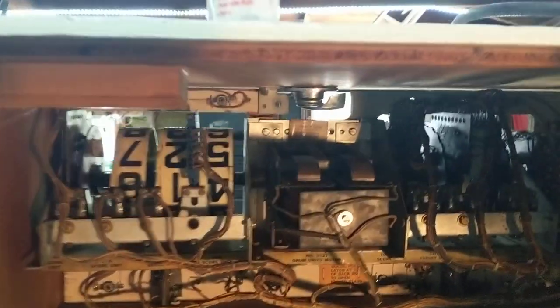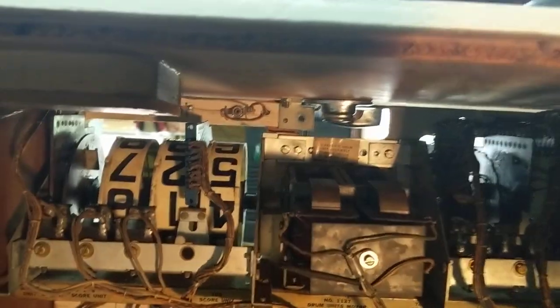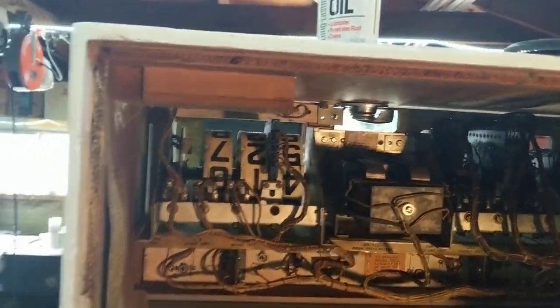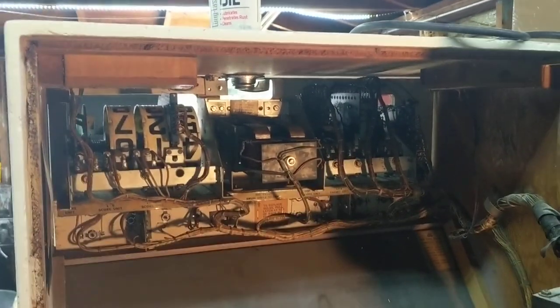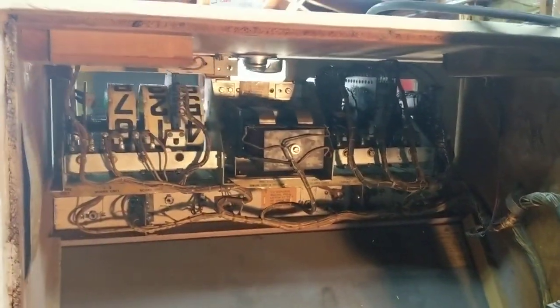Let's go to the back. There's a central motor in the middle here — there's two motors actually, I think for forward and reverse, or maybe different speeds. They're connected to the two different sides of this, and what people don't like is this is a single point of failure. If this motor burns out, which it sometimes does, you're kind of screwed as you can't get new ones. You can rewind it if you're really ambitious, but the problem is they're so old and the lubricant just gets caked up and it just won't spin anymore.